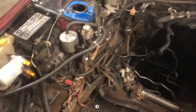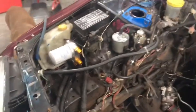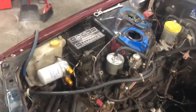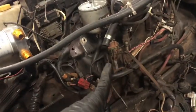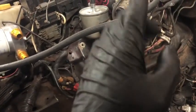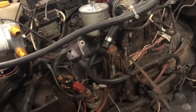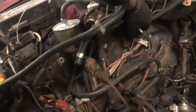After that, I gotta steal that for my power switch solenoid, pretty much like a kill switch solenoid. Gotta steal that, dude. Trying to remember what else I gotta steal. There's a couple other things I need to take from this car. Oh yeah, this fuel pressure regulator, I forgot what that thing is called, and sorry, the flex fuel sensor. So these two things have to be stolen, and that stuff has to go on my chassis on my S14. This MAP sensor can stay here because the car is not gonna have a MAP sensor that's built into the ECU.